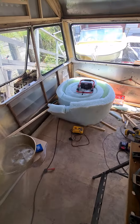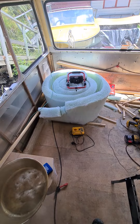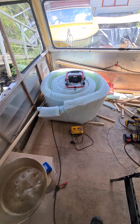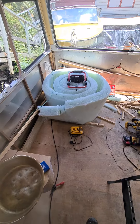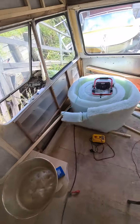It's going to be fully insulated with polyester green wool — it's the non-fibreglass type, it doesn't deteriorate with vibration. It's 100mm thick and I'm cramming it into 25mm gaps, so it's going to be quite dense and quite cosy.